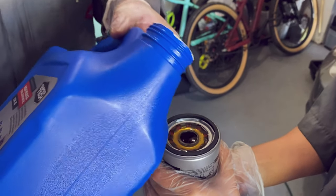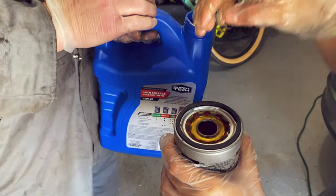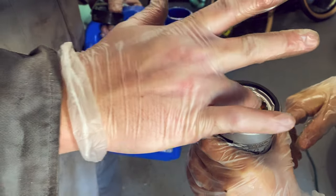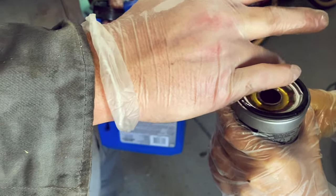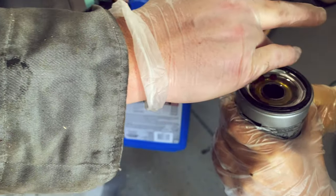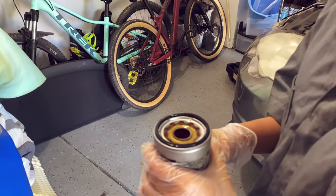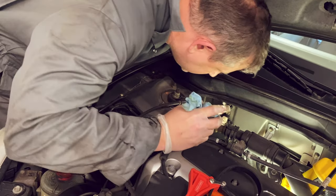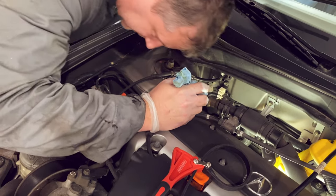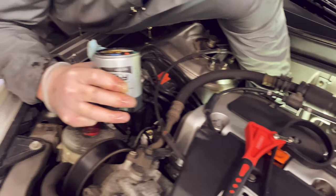We're doing it for a reason and it'll soak up — see how it's soaking up right there? That's good enough. Then you want to take a clean finger, not a dirty one, put it on the top ring and just lubricate the oil ring like that — just go around it. Now it's just about screwing it back on without spilling oil everywhere. You eyeball where your fitting is — you can see it and feel it with your hand. There's the post right there.